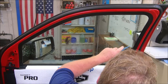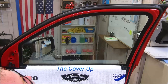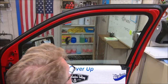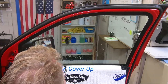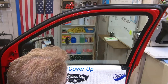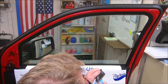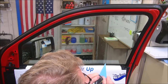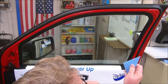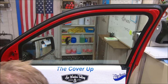This is the blue frog — looks just like the platinum easy reach or the gold easy reach, but it's a lot slicker, works better, and it's more durable. But if anybody tells you that any tint tool will not scratch, they're telling you a lie. The only thing I've never scratched a window with is a rubber turbo smoothie or black smoothie. Keep some 400 grit sandpaper in your pocket. I don't use a pouch because pouches beat up tools — they get dirty inside, dirty tools get dirty nicks and leave dirty scratches. Bottom line: sand this baby.